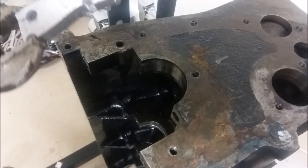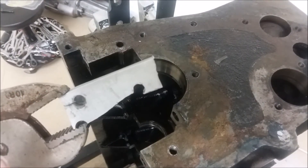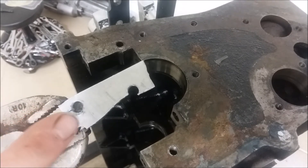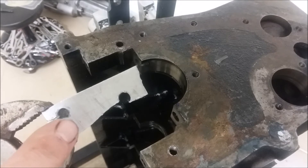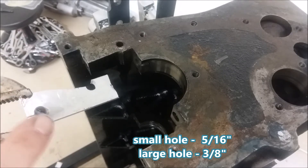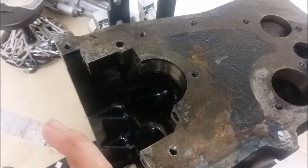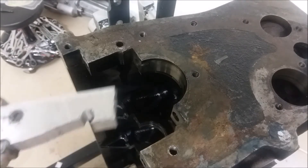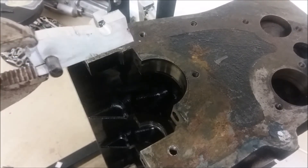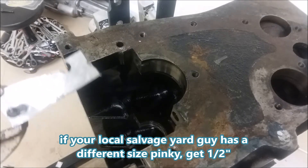You can see a little more detail on the jig and clamp I'm using. I cut twice through that slot — it's compressed now with the vice grips, but that's enough to hold it. If you try to turn it too much it will slip, but if you use little tiny turns at first, it'll go well. I've got one more to go and I am done pulling these pins. One last tip: because the ones in the back are smaller than the ones in the front, do the ones in the back first. Do one with the small hole, turn it over, do the other one with the small hole, then go back to the drill press and drill the bigger hole. The aluminum is about the same thickness as my pinky — I got it from my son-in-law, a redneck fabricator who has a favorite salvage yard in Tennessee.